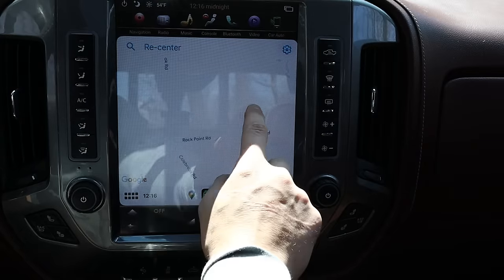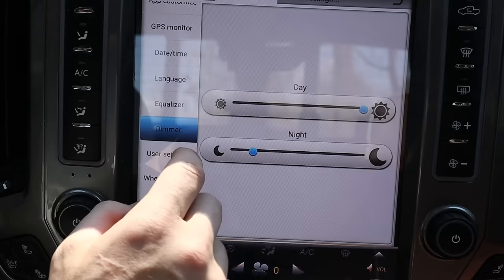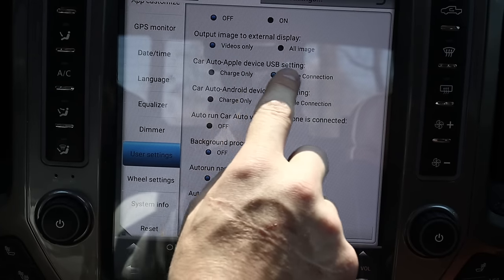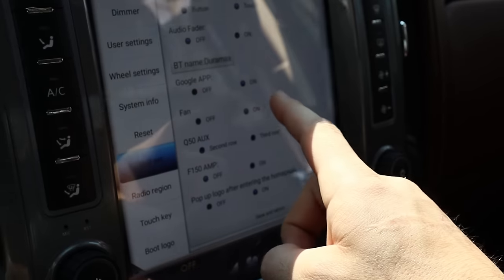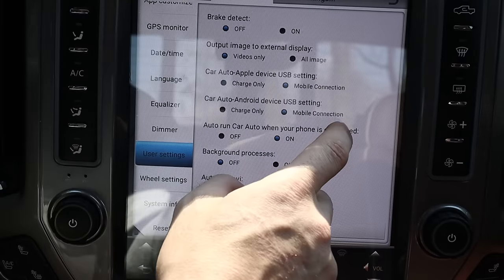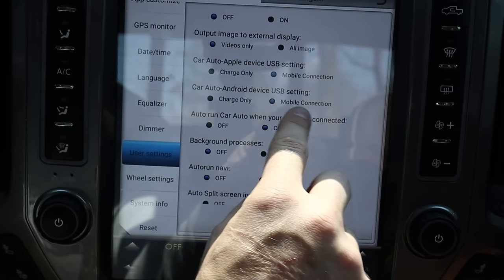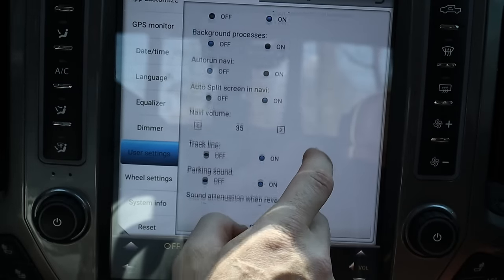As you can see right now, I've got CarPlay going with no cable installed, just my phone, and it works incredibly well. To get your wireless CarPlay — and probably Android Auto as well — to work, you have to connect to the Bluetooth of the tablet, not the Bluetooth of the truck. The Bluetooth of the truck will still be there even though you've removed the factory radio, so make sure to connect to the Bluetooth of the new stereo. Also, under user settings, make sure you have it selected as a mobile connection and not just charge only — mine was set as charge only out of the box, so if you don't change that, your Android Auto/CarPlay will not work.